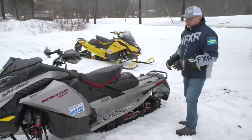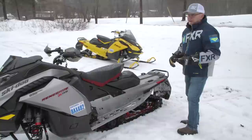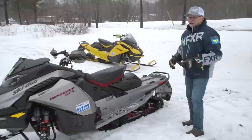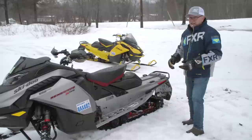A lot of people say that's a tiny little movement — yes, it is. But I'm here to tell you that tiny movement makes a huge difference in the chassis. Skidoo is not fooling around with that. It's the kind of incremental adjustment that makes a big difference on high-performance motorcycles and cars. These are hugely sophisticated vehicles, and it's a cool feature. It's on all R-Motion X models — there are G4s with it too. If you haven't fiddled with it, try it. If you haven't touched it since you got the sled, it's set in the flat position to keep the nose down.